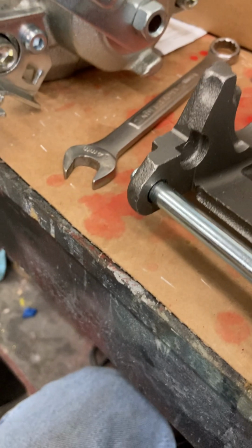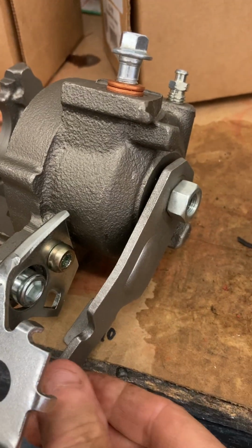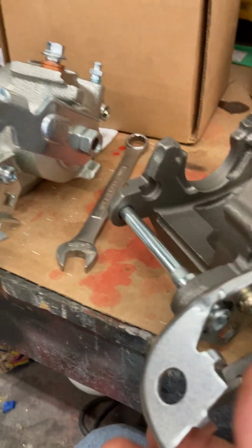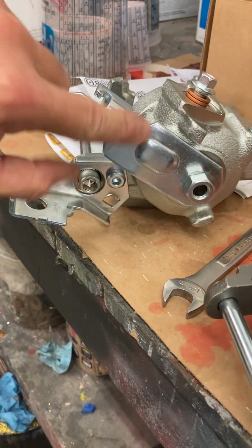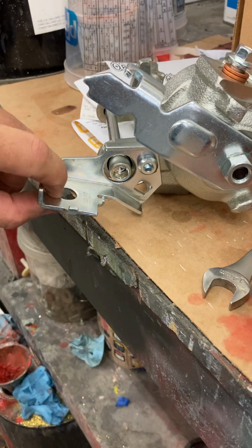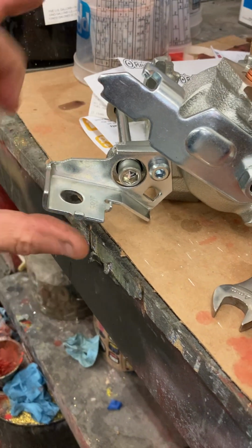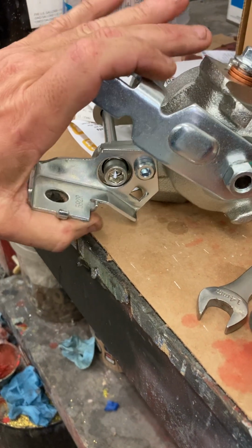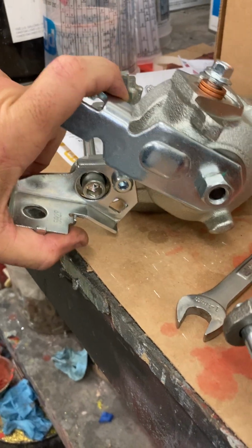So on this one, go right, piston comes out, go up, it locks. This one is just the opposite. If it worked, so let's say I'm looking at a clock right here. This would be to apply brakes counterclockwise, because the cable comes up through here, latches, spring in between. It's trying to pull the emergency brake. So that's pushing together. Counterclockwise, lock, unlock.